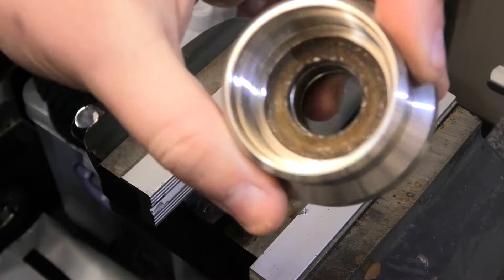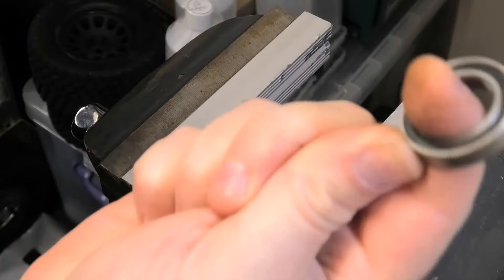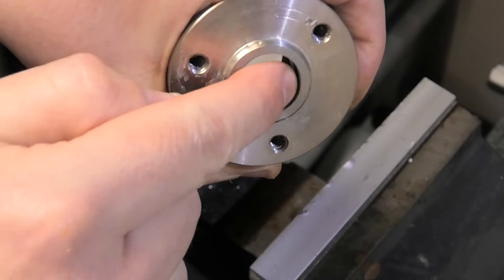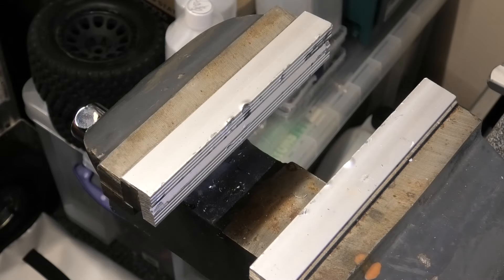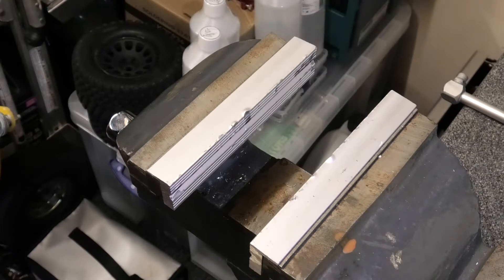There's one at the top and one at the bottom, underneath each of those bearings. The bottom piece will come out fairly easily but can get quite stuck — this is where you may need your slide hammer with a blind bearing insert. Sometimes you can be gentle and tap on the inner race at the right angle and it will pop out. If you're replacing the bearings anyway it's not a big issue, just be careful not to smack it too hard and damage them. A blind bearing slide hammer may be a better option if you have one — you don't necessarily need to buy one just for this unless you get really stuck. Just wiggling that bearing race out — there we go, there's the bottom part of the race and the other smaller ball bearing.